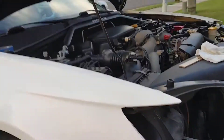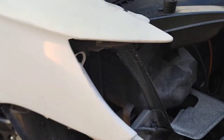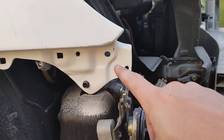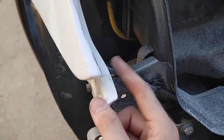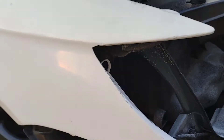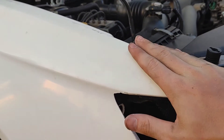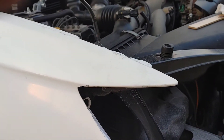This side looks a little bit uglier up in here — I kind of just lost patience and didn't take my time. As far as things you need to shave, you might need to shave these two holes right here a little bit — I widened them. You'll definitely need to shave this piece right here, and this piece a little bit. This whole section is now just glass and resin, no gel coat. I shaved this a little bit, and this whole piece right here is going to need a little bit more bondo to bring it up even with the hood line as well.